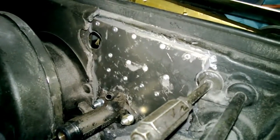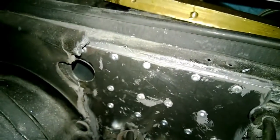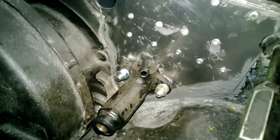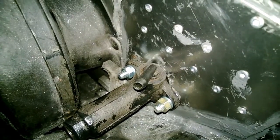So what we did here was, I got a pretty thick piece of sheet metal — this is the sheet metal here, I can't even bend it. We cut it out into a kind of weird shape and we riveted it; that's what all those little spots are, it's rivets. The stuff up here is all JB Weld, and we had to create a new mounting spot for this, because the original piece of metal that went here was trashed too. I'll show you from the inside what it looks like.